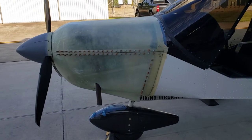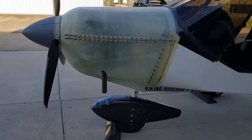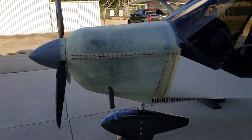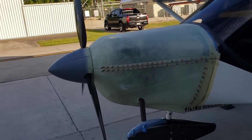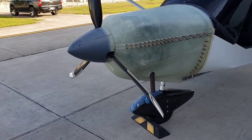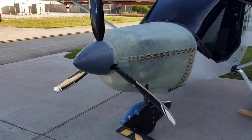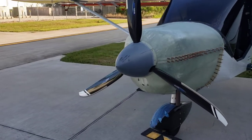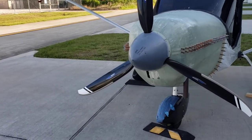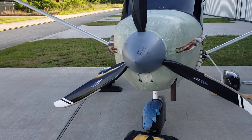It cooled — on the bottom going into the radiator — as well as the Viking cowling. No cowling seemed to do the best on that, but the bottom radiator cowling cooling does well. For gearbox cooling, the Viking is currently superior to my cowling.